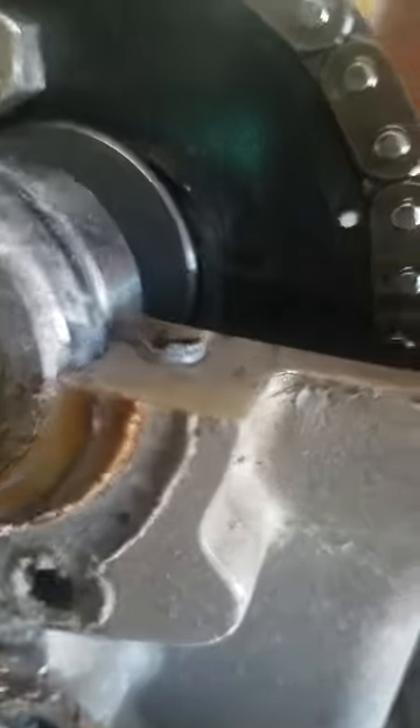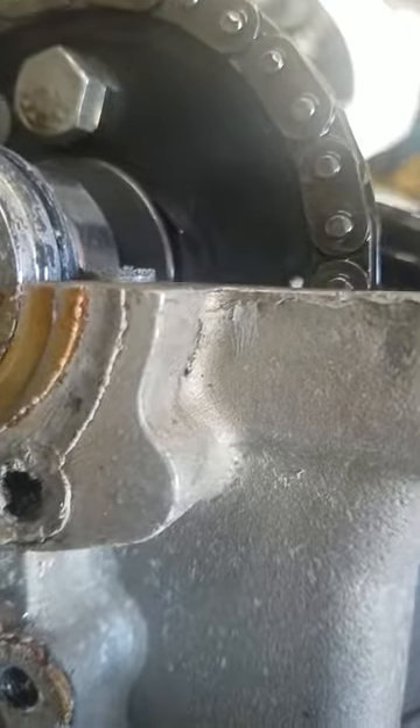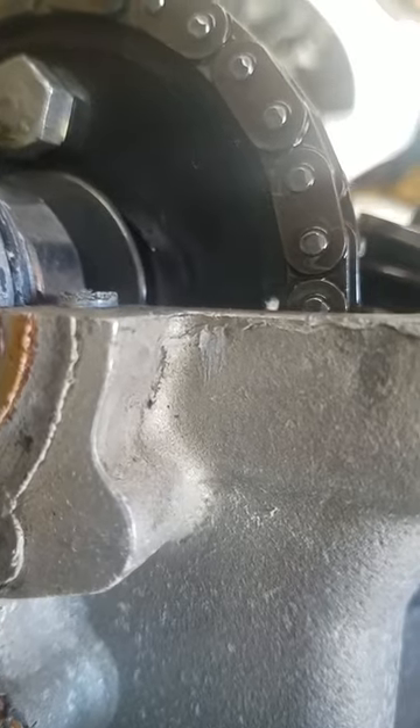On this side there's a dot — I've marked it with white marker on the cam gear — and that needs to be flush with the block at TDC. Line the mark on the flywheel up, make sure you're exactly on TDC, come around here, and that dot needs to be flush with the case level. As you can see, that's perfect — cam timing is correct.